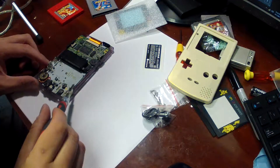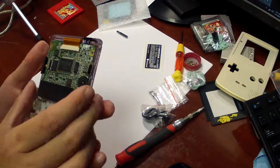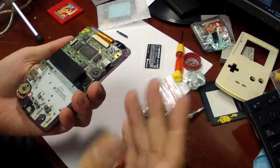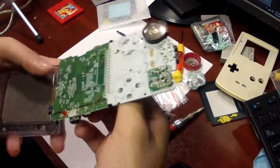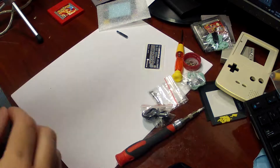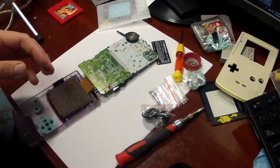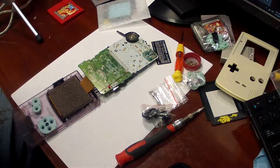We're going to disassemble the inside now, and you need a Phillips head screwdriver for that. There are only three screws on the base of this — they learned their lessons from the original Game Boy. It's still quite tight in there, probably due to the grime and buildup. But looking at the board, other than a little bit of water damage back here, it's not in terrible shape. It doesn't smell like it's been messed with, so I'm going to take a little bit of alcohol swab and clean those contacts.